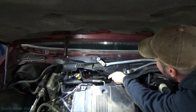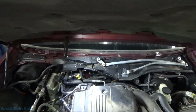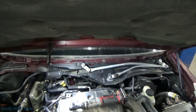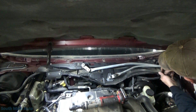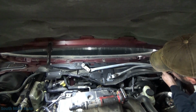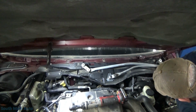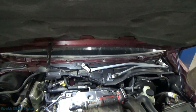Alignment tab over there. Okay, thought it didn't feel right. A little plastic alignment pin over in that corner. So all the bolts we took out are exactly the same. A lot of them go into those little J nuts. So get them all started by hand first, in case one of them wiggled around on you, you have to pull it back up to realign one.